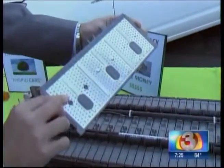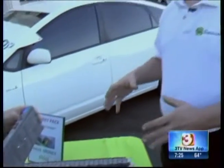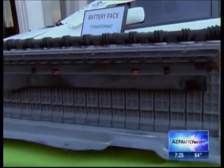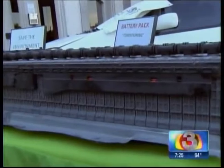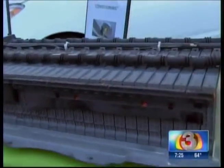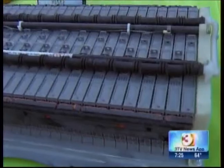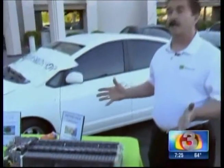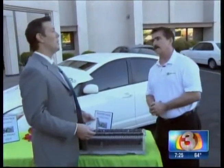So you've figured out how to find what cell is bad and just replace it? Yes. We have a laptop-based program that actually defines where each cell is at. We do a power and energy test that shows what kind of condition each cell is in. We remove the copper strips along here and attach electrodes to each one of them, then determine the status of power and energy in each cell. We weed out the weak ones and replace them with good cells, then discharge and recharge the battery — two cycles — which is typically enough to bring it back to up to 98 percent of its original quality and performance.